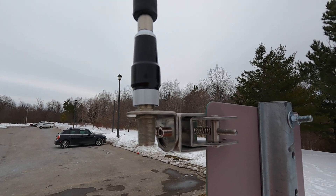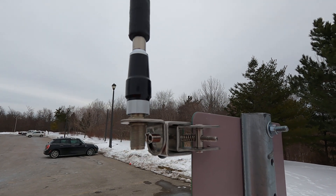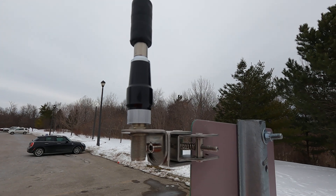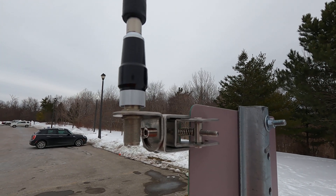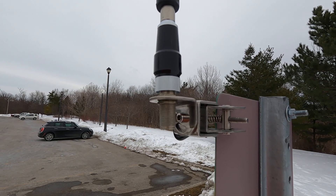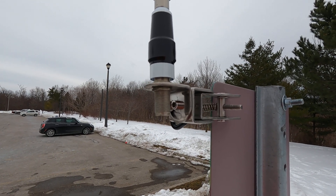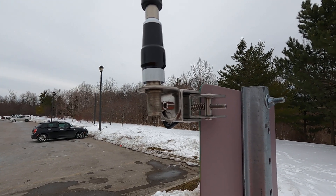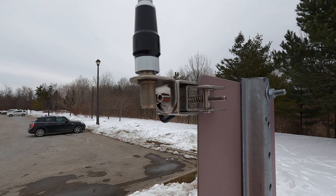Like I showed you with that Comet mount I use with the antenna on the back of the Mini Cooper — here's another way of hacking your antennas. I'd probably buy a couple of jaws mounts: one for the 3/8-inch stud as it comes, and the other you can modify — drill a hole, use a file, and make it fit the other mount. Quick way to get on the air. Thanks for watching.